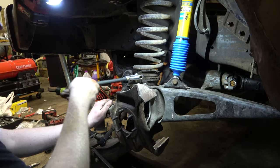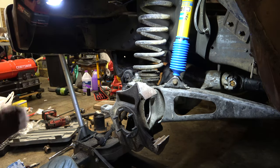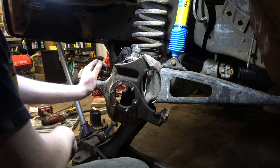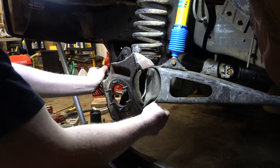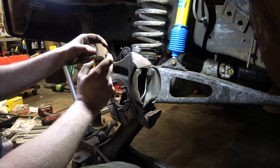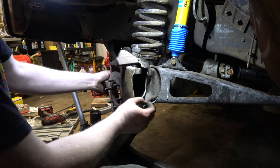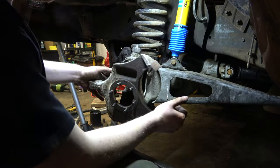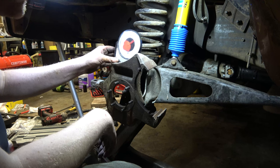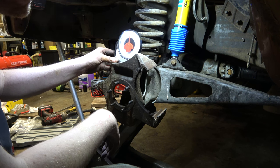That's so cool. Look, that's just trippy, man. I like that. Okay, so this is a little fiddly. I set that bushing so everything was centered instead of being all off. I had too much of an angle on that ball joint that it was kind of binding this up a little bit. So I set it to zero, and we'll let the alignment tech mess with that. So where are we at for caster? We're still sitting pretty good for caster.